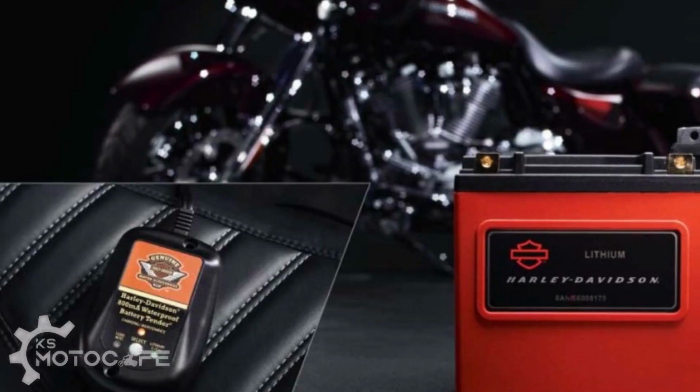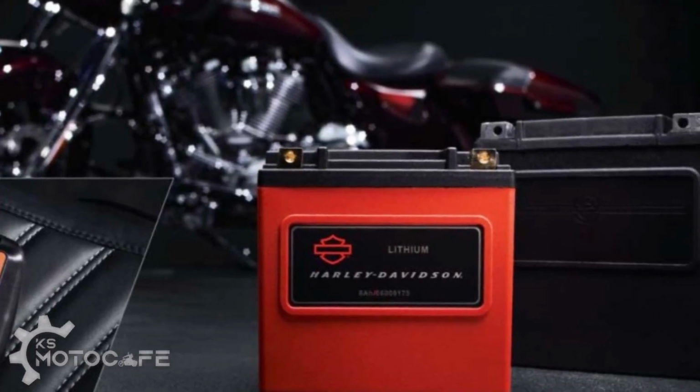The other thing that you need to look out for, especially on a Harley Davidson motorcycle, is the health of your battery. And I actually had an issue with this when I first started out because I didn't trickle charge my motorcycle while taking a 2-week break. And those 2 weeks, I thought it was going to be nothing, but when the weather and the schedule lined up perfectly for me to go on a winter ride, I took the motorcycle out of my garage and tried to turn it on, and it didn't turn over because the battery was dead. And man, that was annoying.